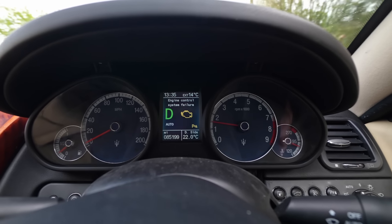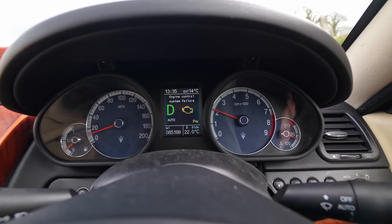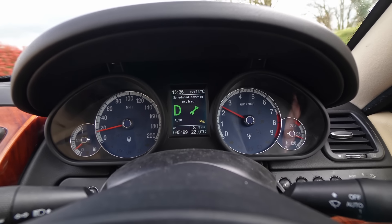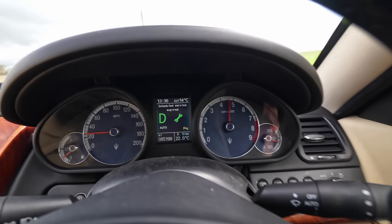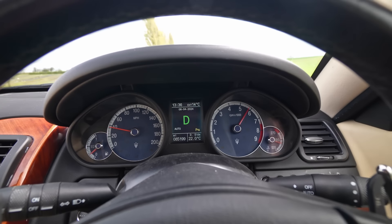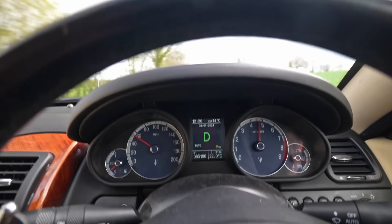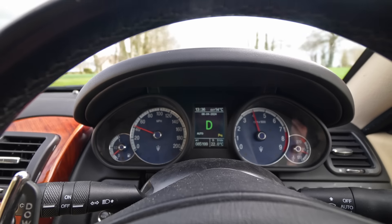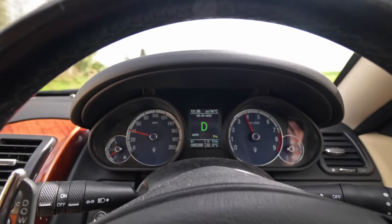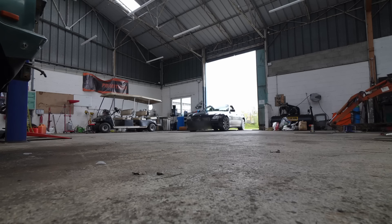It's got no power down there — it's firing on probably six of its eight cylinders properly. The misfire is really just at low revs, so that could be something simple or it could be the variable valve timing.